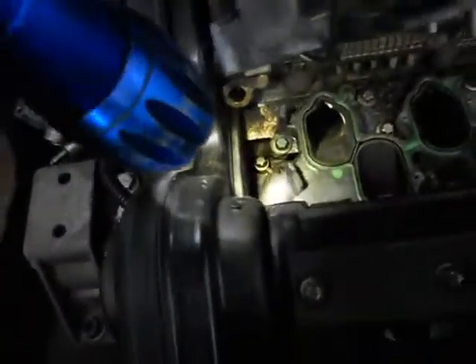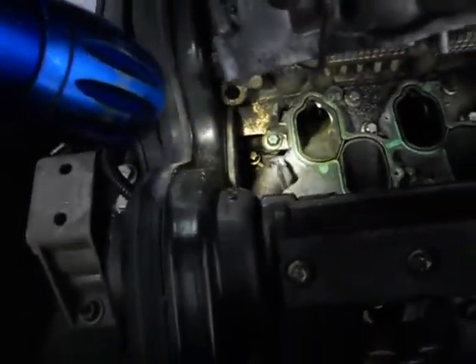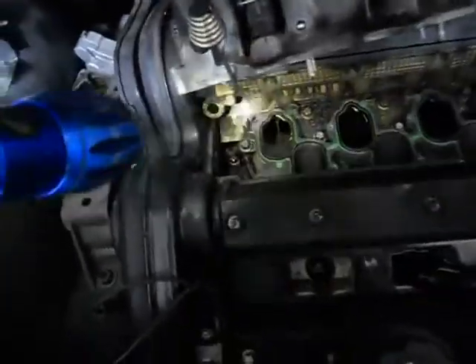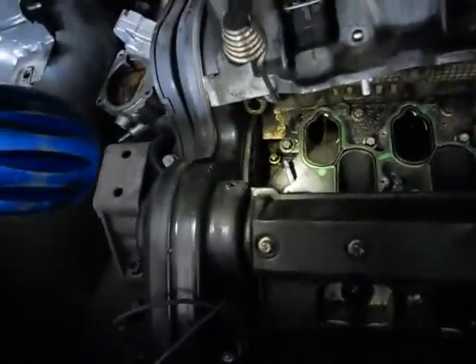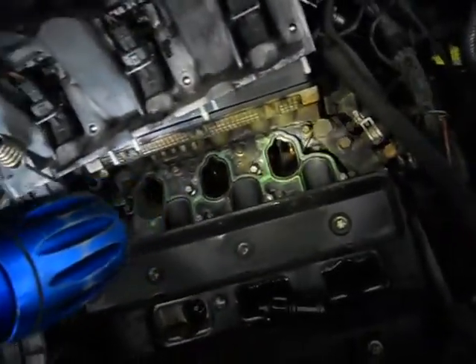So I was going to put plugs, but actually what I took this apart for was the thermostat. If you can see that housing right down there — that thermostat housing. Thermostat is stuck in open position. Temperature is too cool and it keeps throwing a code. At least they have a fail-safe mode where they stick in the open position.